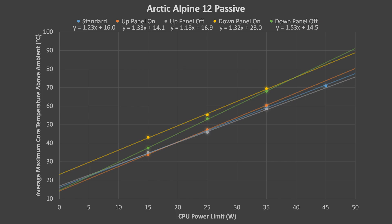The blue line is the case standing up vertically. The orange line is with the case lying flat and the cooler facing upward, with the side panel installed. The grey line is the cooler facing up with the side panel removed. The yellow and green lines are the case flipped upside down, motherboard on the roof and cooler facing downward — yellow is with the side panel on, and green is with the side panel off. With the Arctic Alpine 12, temperatures for the orientations with the cooler facing upward were very close to the temperatures with the standard vertical orientation. The two orientations with the cooler facing downward had significantly higher temperatures, however.